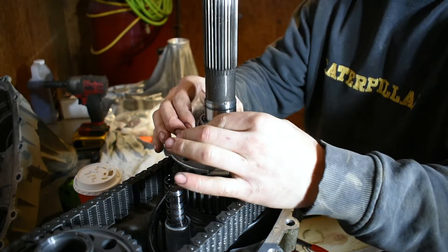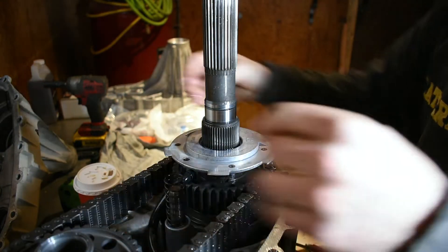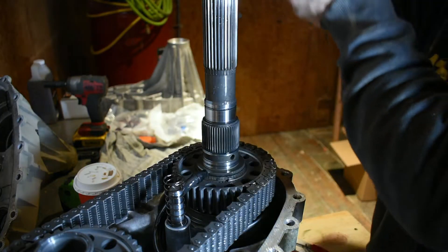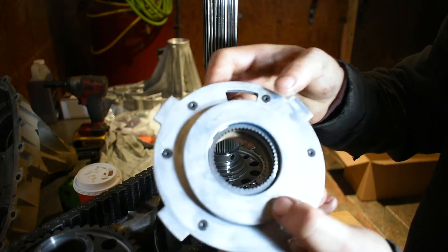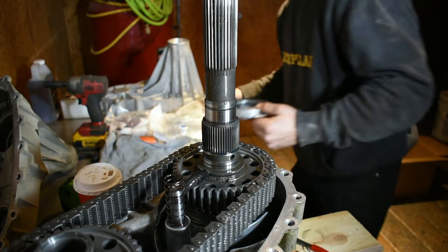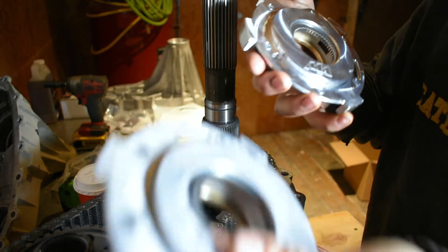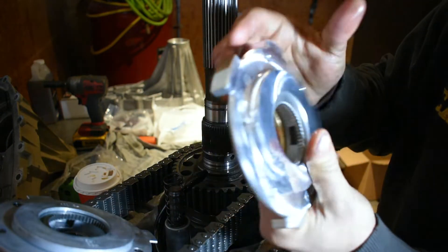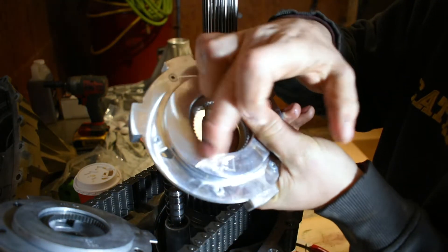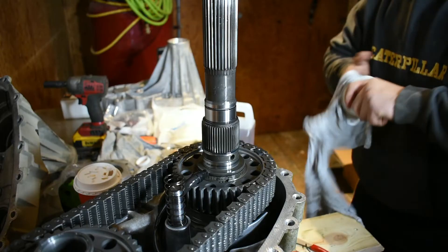Slide that right off - snap ring was first, now our bearing is next. This gear here is your tone ring - this is for your speed sensor. Your pump has this hose here, so carefully pull it back and pop it out of place. Pull your pump off - there's the drive gear, looks pretty good. The pump pumps fine; the problem is GM has a cast aluminum plate and these ears are super thin. On Merchant Auto's fix kit, these ears are bigger and it's also a billet aluminum plate - machined down, and these go the full width of the case.